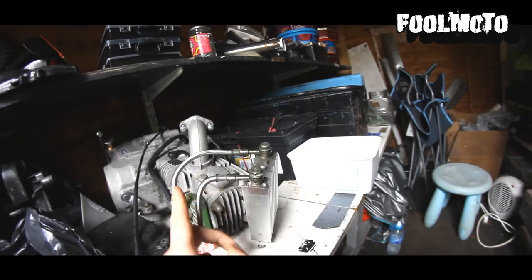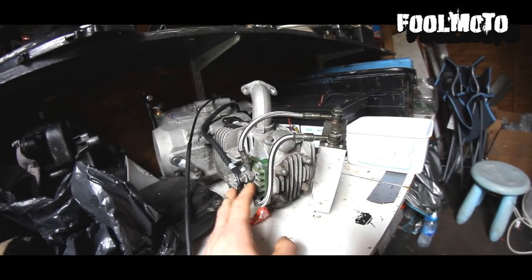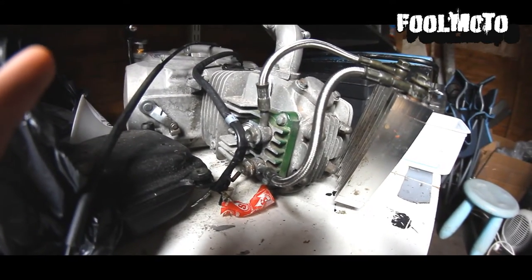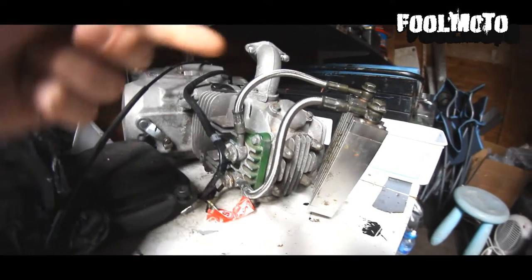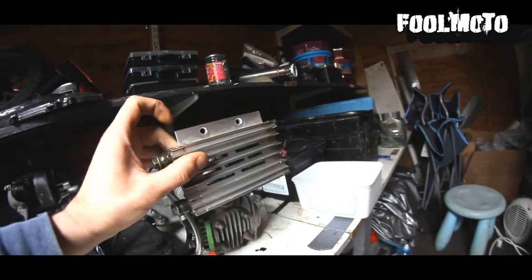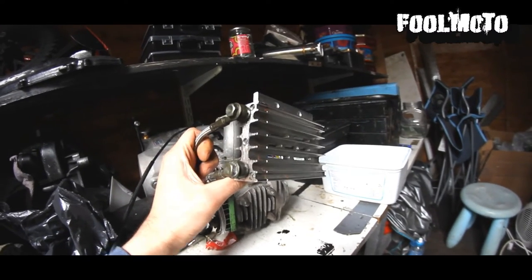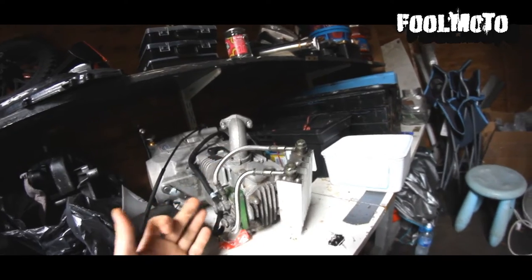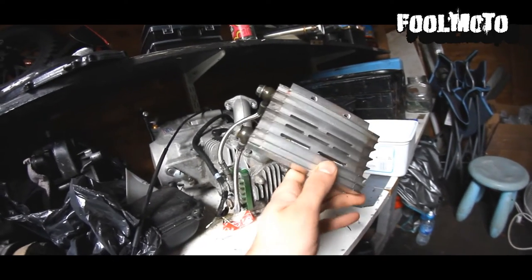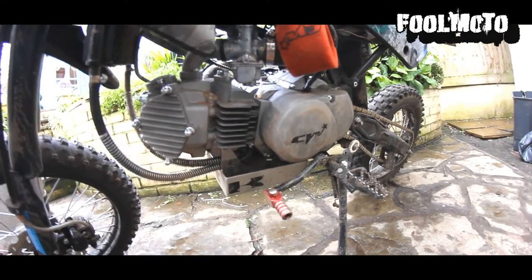This is the radiator I bought for my 125. I think the part with the leads was £20, and that other part was £9.99. If you've got a 50cc or up to a 125cc pit bike, you'll need this conversion plate — it's got two pre-tapped holes for banjo bolts so you can fit an oil cooler, and two holes you bolt through to the frame. I bought one because now the bike is road legal and will be doing long journeys at high revs, so I recommend getting one to stop the engine from overheating.